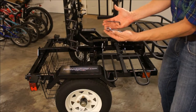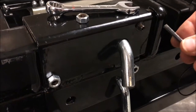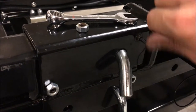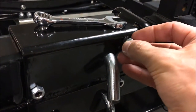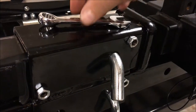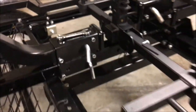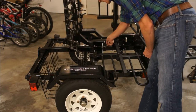We tighten with an Allen wrench and a half-inch box-end wrench. Insert the Allen wrench into the set screw and snug it down tightly — you need to get these pretty snug, about 25 foot pounds. This is what will eliminate the rattle from your racks. Then take the nut, put it over the threads, and use a half-inch box-end wrench or a crescent wrench to tighten it down snugly. The compressive forces and friction will keep these from backing out, although you do want to check them periodically to make sure everything remains snug. Continue to tighten all of the set screws and lock nuts until the entire assembly is snug.